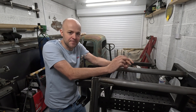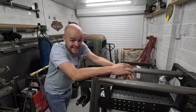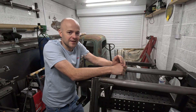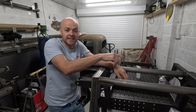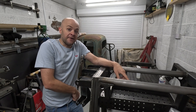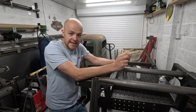Originally I tried connecting the CAN bus to it, because I was told that EDC15 — which is the Fabia ECU — and EDC16 would speak to each other. This was by a well-regarded tuner. But it didn't unfortunately. It did the same thing when connecting — I got the erratic rev count again, and it cut out afterwards. So it didn't work.